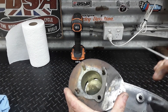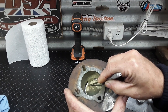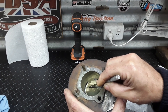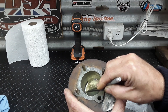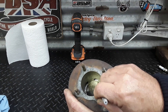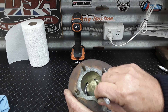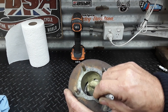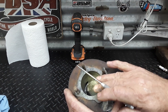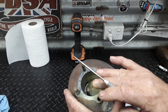We'll get around to the exhaust port and as you can see we've taken those lips out of either corner — there's no lip there now. We're utilising the whole port. On the transfer on this side, we've taken the two corners out and made it nice and level. This isn't a race porting job by any stretch — it's basically doing what the Japanese would have done and making sure all your ports and everything line up properly. We're going to max port to the case, so we're going to split the cases now.